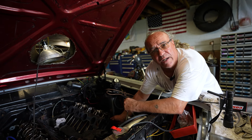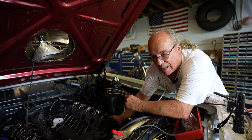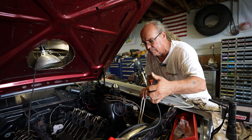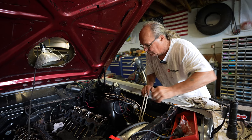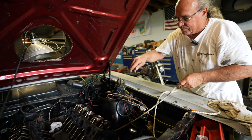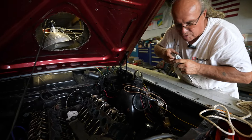I know the air method is the right way to do it and probably a quicker way, but with these towers they're in your way for two of them and it's very hard to get the tool on there to even put the air in. Make sure everything's good — yep, that's tight, that's good. Now I could do these two; if it was loose I'd click it again.